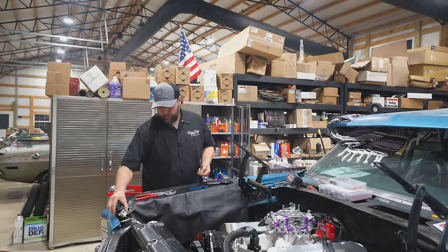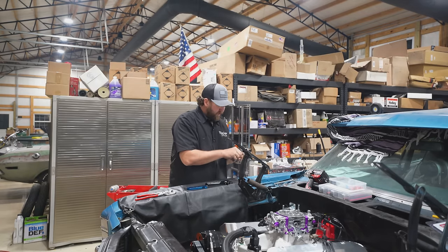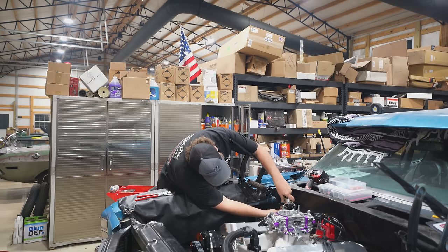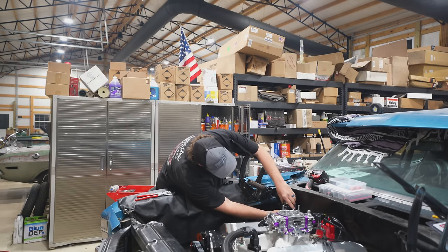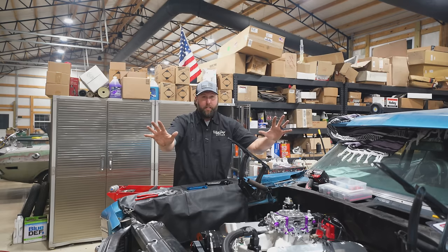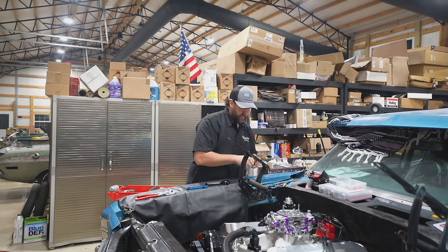These regulators have come a long ways over the years. Those cheesy ones with the twist dial were really common when I was in high school. But what they don't tell you is the number on the twisty dial isn't necessarily pressure, meaning you could turn it to 7, but that doesn't mean it's 7 PSI. Just be aware. They're kind of junky, is what I'm saying.